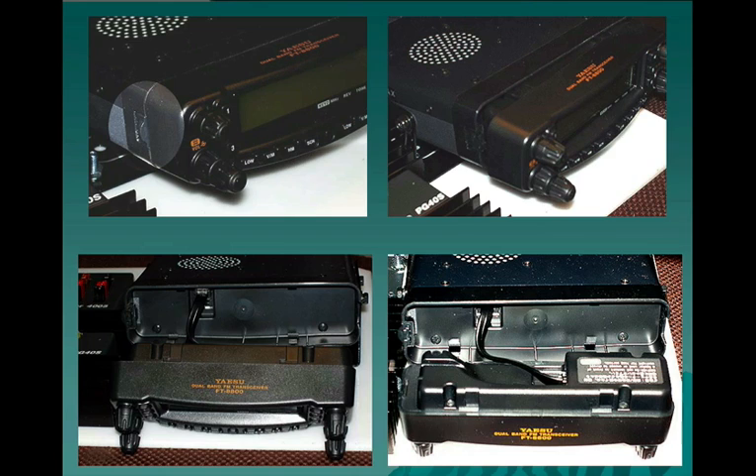When you do, you can see in the right photo on top, the front panel will slide to the left. As it slides to the left it will disengage from the front of the radio, and you can see it disengaged in the bottom two pictures.